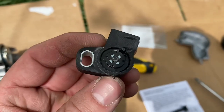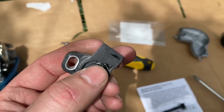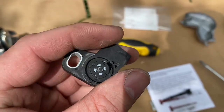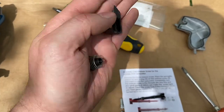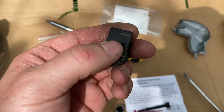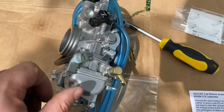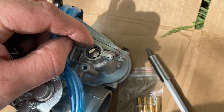Okay guys, this is what it looks like when it's ground down. See the spring right here? When this rotates, it turns the spring. So we're going to take that assembly out, just like this. Now what we're going to do is take some JB Weld and put it around right here. Don't fill this hole in here because that still has to go right there.